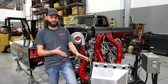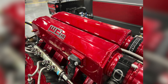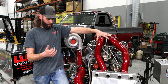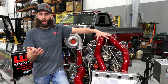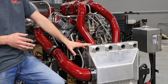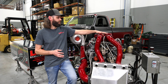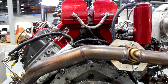One of the most important aspects of our intercooler design, and why it works great with our billet fabricated individual runners, is that you've got a left and right runner — not one single plenum. With two separate runners you have two inlets, so with a typical universal intercooler core you'd need a pipe split or Y into two, which makes equal flow to both sides difficult. When we designed our intercooler core, we went with one four-inch inlet and two three-inch outlets, allowing us to evenly distribute air to both sides of the engine. We also have a connection line on the back of our intake runners to further even out airflow distribution.